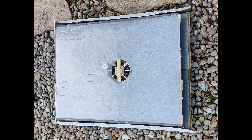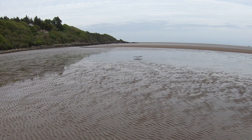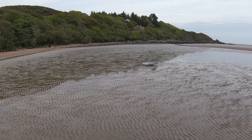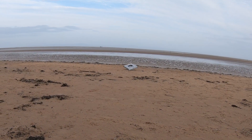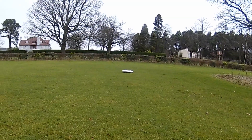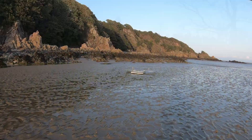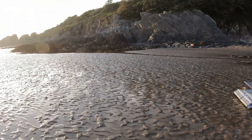This design, with air partly blowing down through the lift motor but also picking up ram effect, is a hybrid. Even without the outboard wings it still picks up ram pressure — although, as I've said, it's actually detrimental, which is why the front appears to be ramped the wrong way; it's actually the right way. But in adding those outboard wings, you gain so much pitch stability.